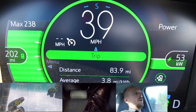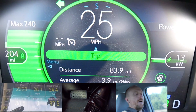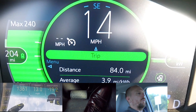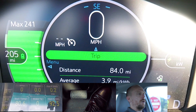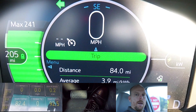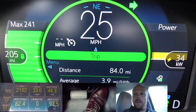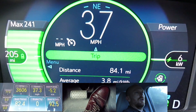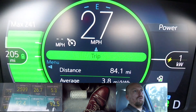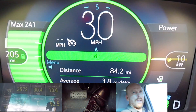This will bring you to a complete stop and you don't need to use the brake pedal at all. But one of the issues is that if you don't hold the regen on demand paddle down, you'll start to move again. Here we are completely stopped — I have regen on demand on and it's holding me in place. The reason I don't like D plus regen on demand is because the regen on demand paddle turns with your steering wheel, so you don't always have it available. That's a big negative to me because you need it available whenever. Going through a corner, it's a really awkward movement to get regen on demand while in D. That's why I usually use L — it's just a way more streamlined, easier way of driving.